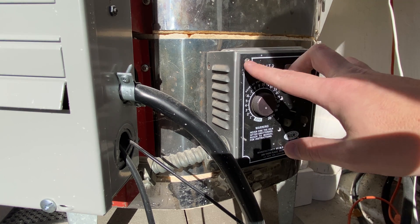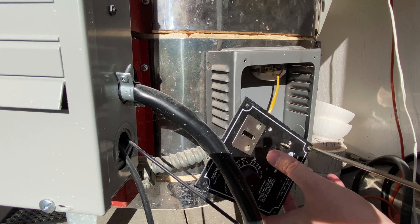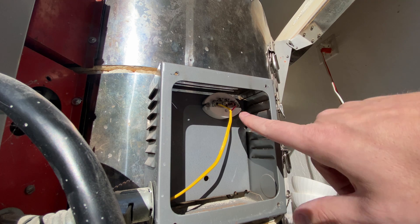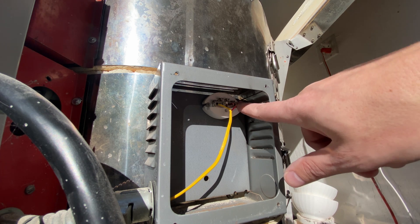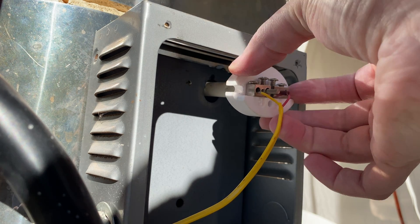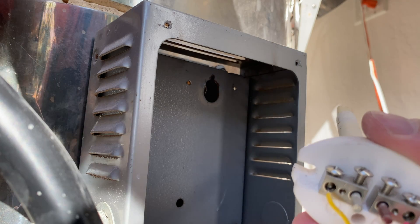We need to take the front plate off — it just has a couple of screws. There's a knob and stuff but that's not functional, it's just keeping things closed in. There is the face plate. The other thing is this yellow wire — it's a special thermocouple wire that goes into the kiln controller to measure the temperature. This here is a thermocouple block — it's basically how it's mounted and provides electrical connections. To pull the thermocouple out I need to undo that. I got the screws out so we should just be able to pull this out.